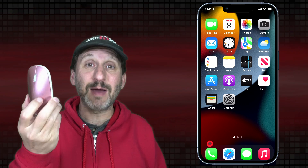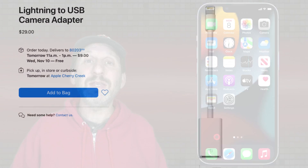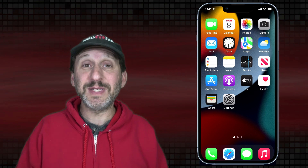What seems to work all the time is just something cheap like this — it cost me $10 on Amazon and it's a cheap, super lightweight mouse. But you can also use a wired mouse. The way you do that is you get a USB adapter that connects to the Lightning port on your iPhone or older iPad, then connect the USB-A side to a wired mouse. If you have a newer iPad that uses USB-C, you just get a mouse that uses USB-C or an adapter to go from USB-A to USB-C.